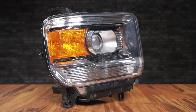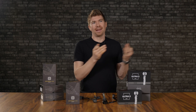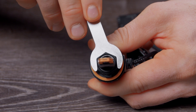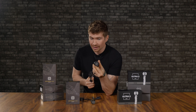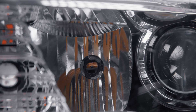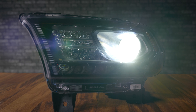Let me show you in this housing how important it is to have a bulb that adjusts. Look at me adjusting the GTR Lighting Ultra 2 inside the headlight housing — look how much the beam pattern changes. You're going to have to play with the bulb to get it just right. In this GMC projector housing, the Ultra 2 wins in brightness at about 18% brighter after 15 minutes. If you purchased an LED bulb from Amazon or eBay and it's not adjustable — meaning you can't clock it and turn it — that's a major problem. The LEDs need to be shooting at the 3 o'clock and 9 o'clock positions. That gives you a really good beam pattern, whether you have a projector or reflector housing.